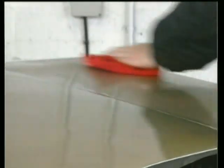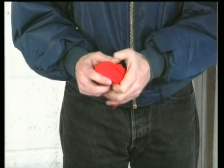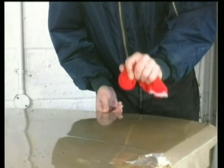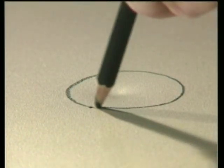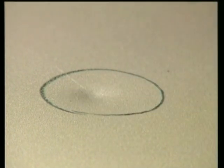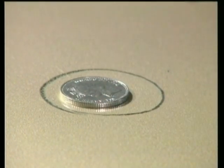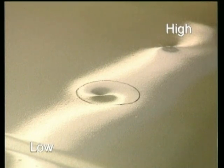We shall now make some lows on the practice bonnet. Ensure the bonnet is polished. Get a snooker ball or something similar and to avoid damaging the paintwork, wrap it in a soft cloth. Then hit the bonnet in a few places using different force to vary the extent of the damage. Pick a flat area and make the dents at least six inches apart. Once you have made the dents, circle them with the chinagraph pencil. As you look at the dents you will see that a dent that looks about the size of a 5p actually affects the metal for an area about the size of a 10p. Now position the light so the reflection appears near the dent. See how as the reflection moves across the low it spreads around it. A high looks just the opposite — the reflections seem to be pulled together.